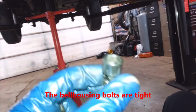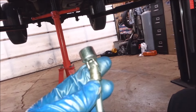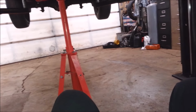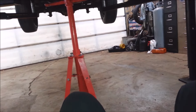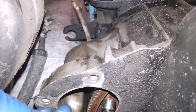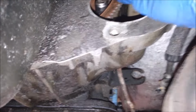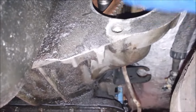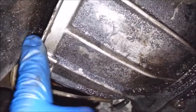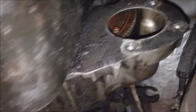Here's how I deal with the torque converter bolts. I put some dum-dum on the inside of a little Craftsman 14mm swivel socket on a 1/4 inch drive. And I put the nut in there. That way it doesn't fall out. It stays in there real good. I'm on the starter side here. I'll just stick this in here and start it. If you use your fingers on this, chances are that sucker's going to go right where you don't want it to, and it'll fall out and go down here, and then you got to fish them out or take the transmission back out.